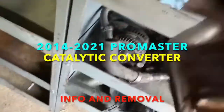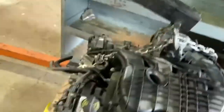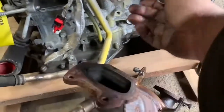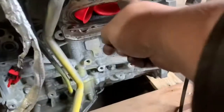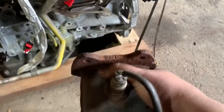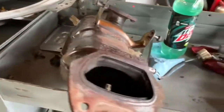This is your catalytic converter. What it does is it bolts to the side of the engine like this. There's the upstream oxygen sensor at the top. It is retained by those two bolts, and aside from this gasket — see this little lip here — that hooks onto this thing. So it's actually only the upper two bolts that retain it. They're 14s that grab it from the top, and out comes your cat. The hard part is getting it to separate from the exhaust flange because that stuff's all rotted and old and runs at high temperature, but it's not rocket science. It's fairly easily accessible on the front cat. The rear cat is worse.